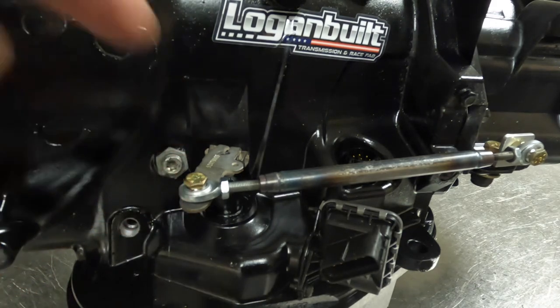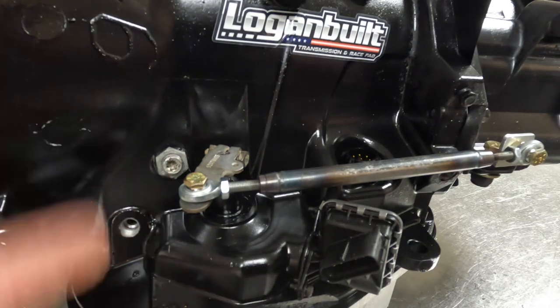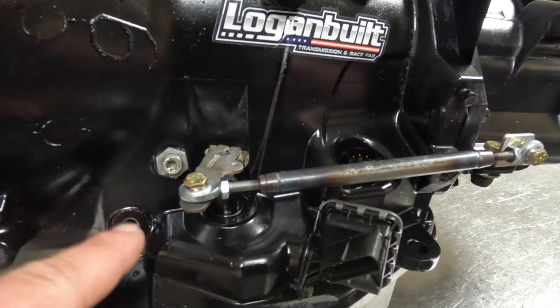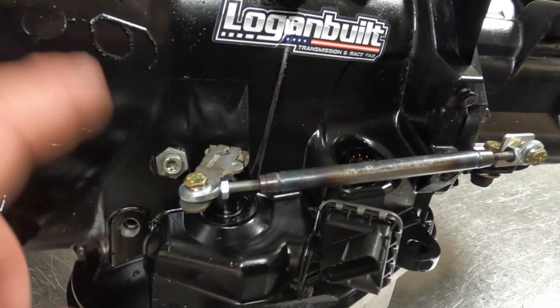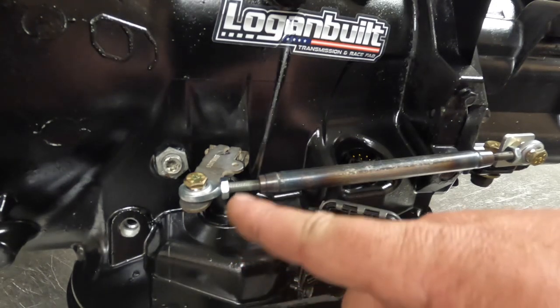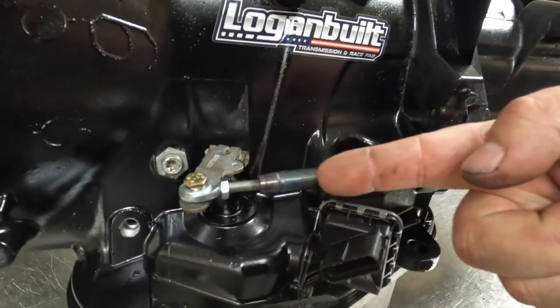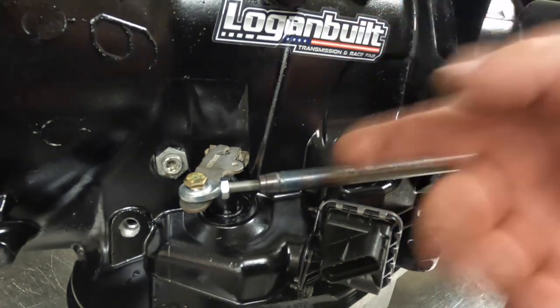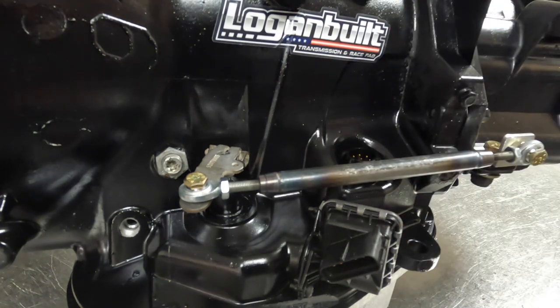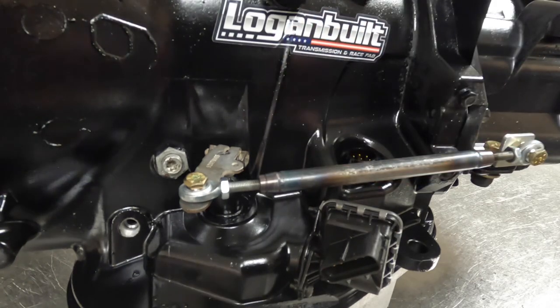You'll feel on your TV lever — if you were to grab it and pull it, you'd feel where it has some spring tension. This is set just before it has any spring tension on itself. If you're running a non-gear-in valve body and using this to set your line pressure, you hook a line pressure gauge up to the transmission and shorten this tie rod, which will pull the TV lever backwards, until your transmission builder's target line pressure shows on your gauge.